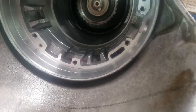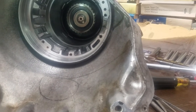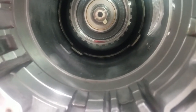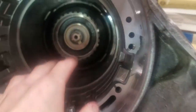I was trying to do it wrong for the first three hours or so, and then I figured out how to actually do it, and even then it required a certain level of absurdity to get it to go in. Unfortunately, I already have the third gear set in there because the input shaft — this guy right here — would not stay. It's like it floats; it's a floating input shaft on this car. It would not stay in place without that snap ring on it, so I had to get everything before that snap ring to go in so that it would actually stay in place so I could film a video, because I had to hold it the whole time. It was a very painful ordeal.